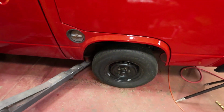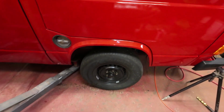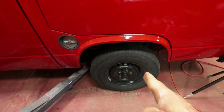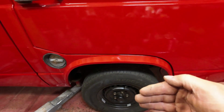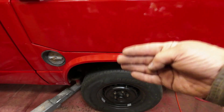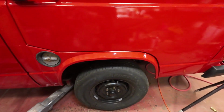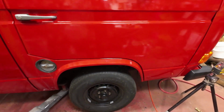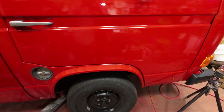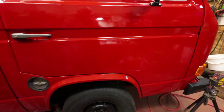Yeah. So that straightening out the caster adjustment, which is angular this way, right? Then it made the camber adjustment, pulled it in so that it's exactly right now, zero top to bottom with no load. So that's good. I'm happy with that. Now I'll get the other side done, and then I'll go after checking the toe-in once again. And maybe the toe-in will just lucky out and be right.